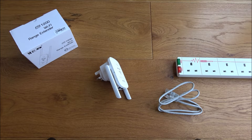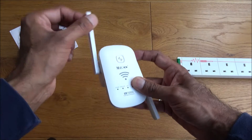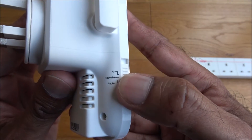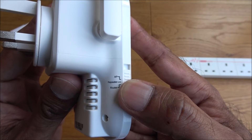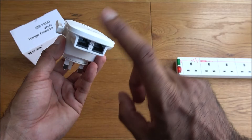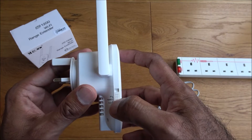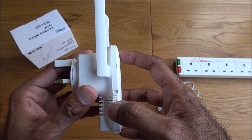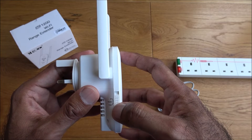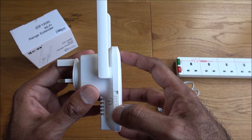Let's make a start with configuring this Wi-Fi range extender. There are three modes on the side switch. AP mode is for when you have a wireless router but dead spots in the house — you plug a cable in to provide connectivity to the extender. Repeater mode is for areas with very poor signal, providing a repeating method. Router mode is for when there's no existing wireless network and you want to set one up.